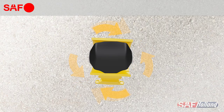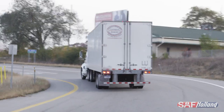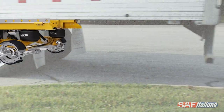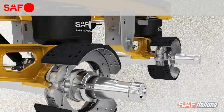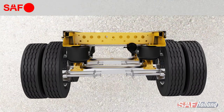In addition, torsional forces are introduced when your trailer shifts from side to side, such as during cornering, changing lanes, hitting potholes, or even curb strikes. Our external void design allows the bushing to flex, keeping the tires in contact with the road surface. This is critical to roll stability and vehicle handling, as well as for prolonging tire life.